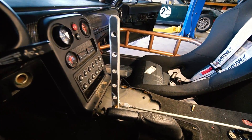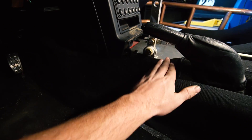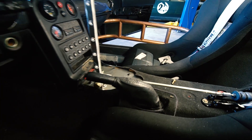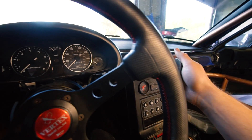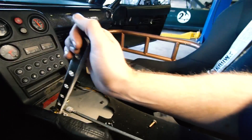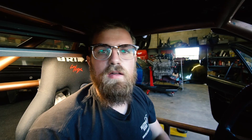Take a look at that — came out nice and clean. From here all you see is the handle and the rod sticking back. We have carpet that's going to cover this, so you won't see any of the plate or anything — it'll be those two slits, shift boot, removing the factory handbrake since we can't use it anymore. It'll just be a nice piece of carpet with the handle up and the rod going back. Should be very clean, very sleek. Yeah, that is in a good spot, man. Really happy with how this came out, really happy with how it looks. Not in the way at all — I can get full throw out of it without my arm going past the seat. Seems super sturdy. We really won't know until we have the brakes hooked up and bled. I still need to order my lines — now that I have the master cylinder placed, I can measure for my lines to go back to the rear calipers. I have the carpet, I need to order a shift boot, and we can wrap this thing up. So for today, that's all the progress we can make.